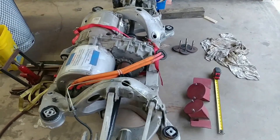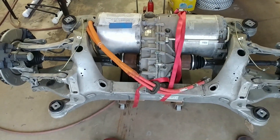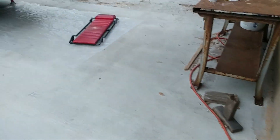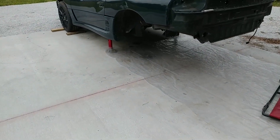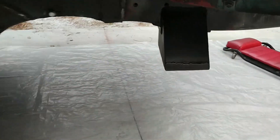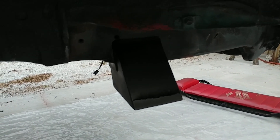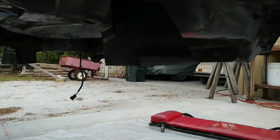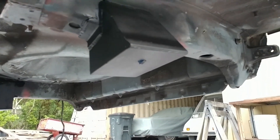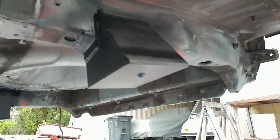In the meantime, I've pulled out the motor — just undid the four corner bolts, suspension stuff, brake stuff. When we first put the motor in, the mounts under here were unpainted and they got kind of rusty. So I went ahead and wire wheeled them all and hit them with a self-etching primer a couple of days ago and just now hit them with some black Rust-Oleum.